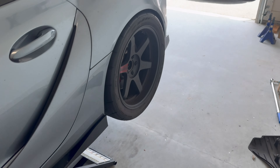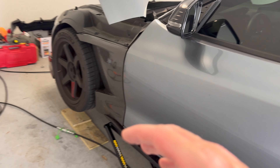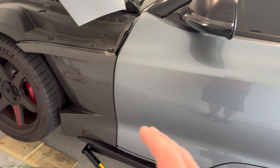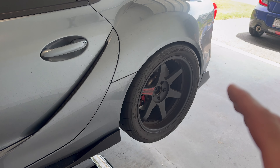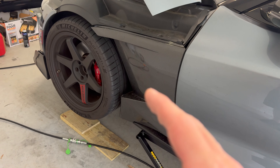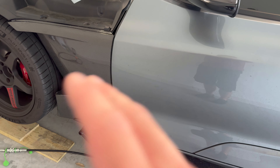I already got the wheels in the back loosened up so I'm going to take these off. Unfortunately I don't have the conversion, so it's just the bolts. I've had this problem for a long time where it kind of vibrates at like 30 miles an hour. I've had all of these wheels balanced like four or five times and we haven't figured it out, so I'm thinking it might be the PS4S tires in the front because it wasn't a problem on stock wheels. When I put the PS4S tires on the front, that's when the issue started, and I know it's not the rear because I can swap the rear out for the Welds and it's not an issue.